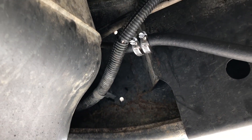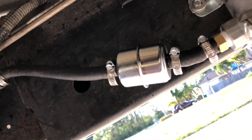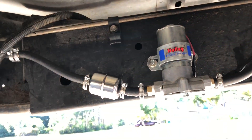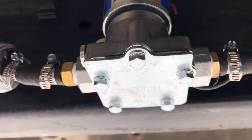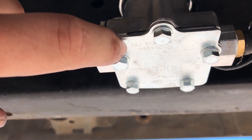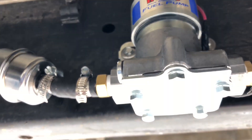Or you can put some kind of a flare on the end and then you can use one clamp, but nothing wrong with two clamps. From there, a little bit of fuel line goes to a metal inline fuel filter — I bought this simply to keep trash out of the pump. That is the only reason; it's not serving as a replacement for the regular stock filter, just to keep trash out of the pump. Also, inside the pump at the bottom, to get the most fuel pressure you want to pull off all of the fittings — there's a little tiny screen that sits inside the inlet. Just tip the pump upside down and it'll basically fall out. That will get you the most fuel pressure possible, and that was the whole reason for the inline filter — so I could remove that screen and not worry about the pump getting destroyed.